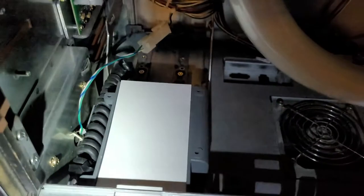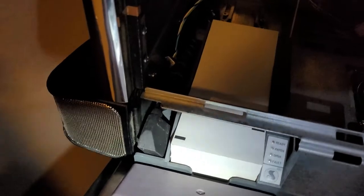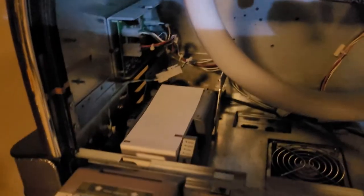Up in here there's an actual cable right here — it's like an old phone cord cable that plugs in right here. That's your communication cable. You gotta be real careful with this cable — you can see it stretches out. I taped mine right there because I had to solder some stuff back. These cables are like 30 to 40 bucks — I don't want to pay for a new one if I can fix it myself. So I did. Just be really careful when you're taking this out. I'm going to go ahead and show you, Murray — if you're going to do it this way — there's a spring-loaded deal here. You push this in — you hear that? You have to hold it in as you pull your deal out and kind of jiggle. It'll let you release this whole thing.